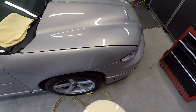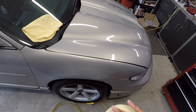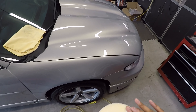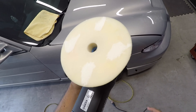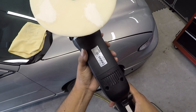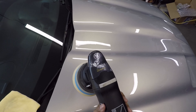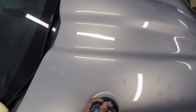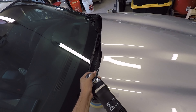I'll just put four little dabs up here and work it in. I'm using a CarPro gloss pad — you can use a foam finishing pad of your choice. You can see what I put on there. I'm actually going to work a larger section than my previous pass and step it down to 4 on the Rupes, working this entire section with a faster arm movement.